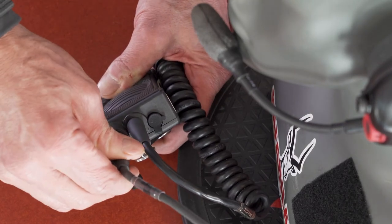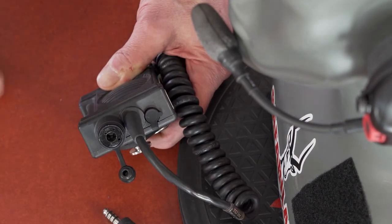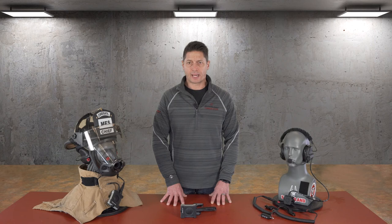If the fire speaker mic is subjected to heavy water spray, position it face down after use and allow it to drain and dry completely before placing back in service. To clean the headset jack on the push-to-talk or fire speaker mic, visualize the chamber and attempt to clear any debris before gently cleaning with a dry cotton swab.